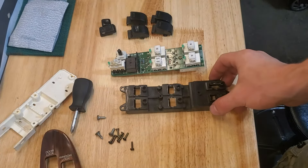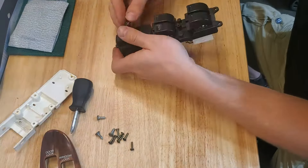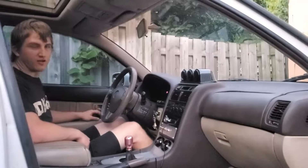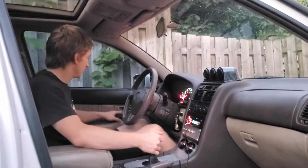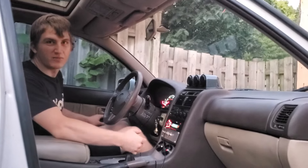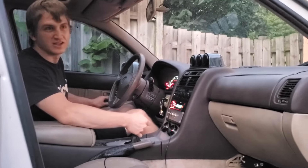I've cleaned all the contacts and now all we have to do is reassemble it the opposite way we disassembled it. I've reassembled the master window switch and installed it in the car in reverse of the removal. Now we're going to test it out. I'll turn my key to the on mode, roll the window down which worked before, and now roll it up. So there you go — now when I'm driving down the highway and I want to roll my passenger window up, I can do that. If you want to fix your window switch for free, that's how I do it and it works well.